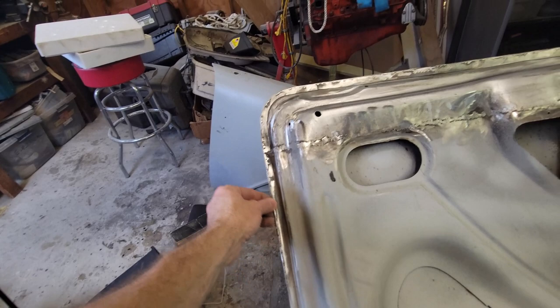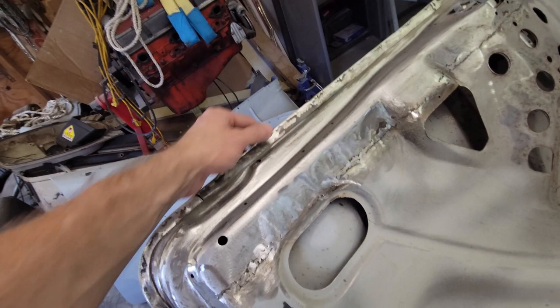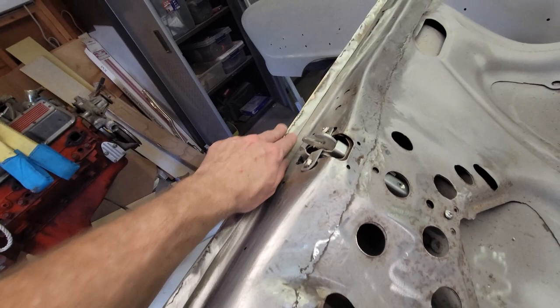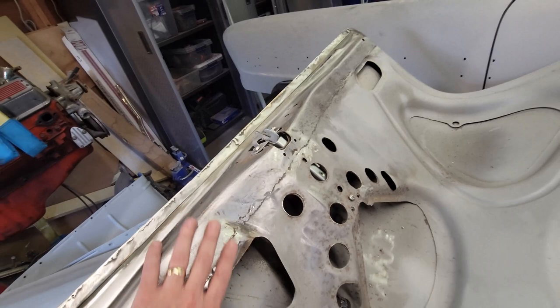I got that done. One thing I did off camera is I took my flap disc and my grinder, and I touched up this edge, because when I built this edge up, it was all welded along this far edge, and that was all ground down to make this shape. So the weld bead was a little bit proud, sticking up a little bit, so I just ground that down, because I am going to take my time and fair all that edge out and make it look smooth, so that when you grab it, because this is going to be something that people will touch, raising and lowering the trunk lid, I'm going to smooth that out too. But now I need to hit it with primer, and then we can go back into the trunk and start laying down some body filler.